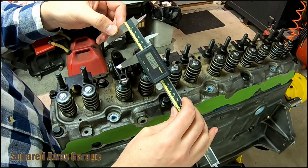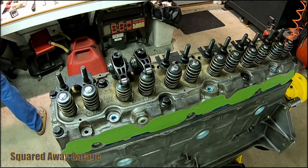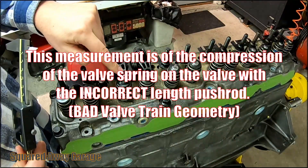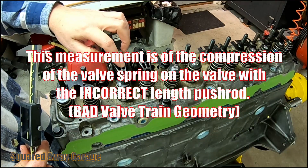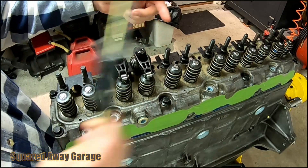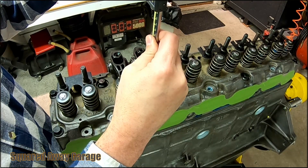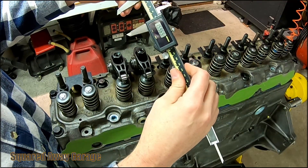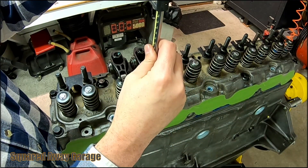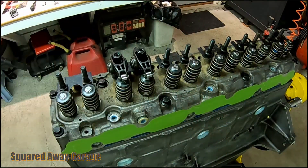With the corrected geometry we come off with 1.5600 inches. Now I've barred the engine over and the exhaust valve is open — same measurement, same place — 1.5965 inches. Let me measure that one more time... 1.5965. Okay, repeatable.